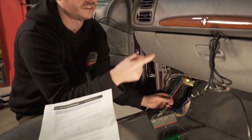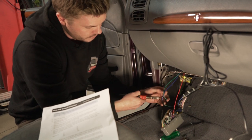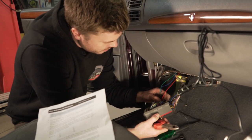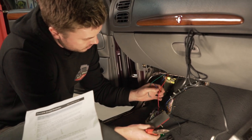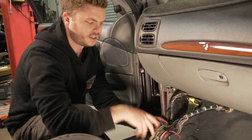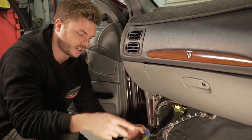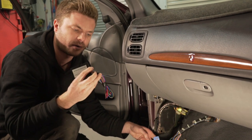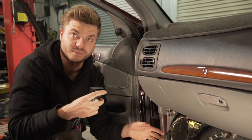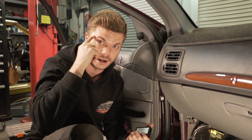So we're going to actually locate all the wires that we need to connect up, tape up which ones they are and what they're going to go to on this module. This pink and green wire is going to go to the brown wire on this module. We're doing that now so we have an idea and make sure they're on the right track — we don't want to get halfway through the job and find out something's different. We're being smart for once rather than just going for it.